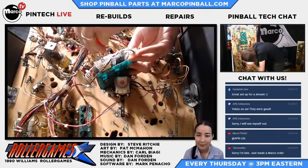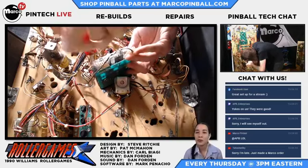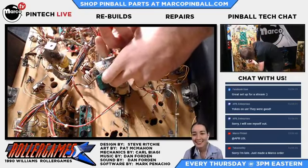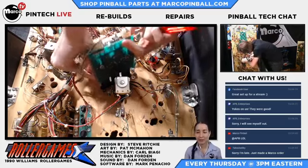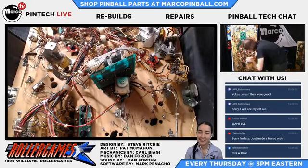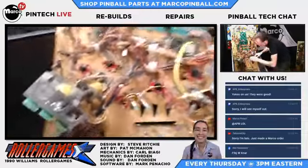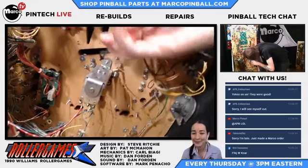Tell us why you're doing this. Why do we have to remove the pop bumpers to clean the playfield? Why can't you just kind of lift it up and shimmy underneath? Because to be very thorough you need to remove the entire assembly. The reason I wanted to do this was to replace those broken yokes - I like to do things once. So during the disassembly process, replacing those things is just kind of a no-brainer.